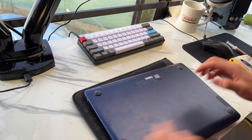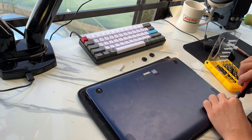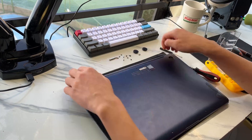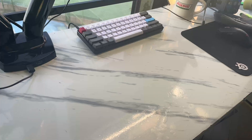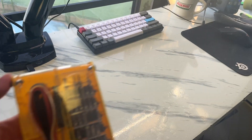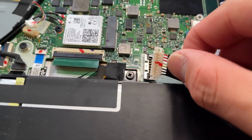Alright, let's open up the laptop. There are going to be a couple of screws, some of which are hidden under the rubber feet. In this particular case I have security screws, so I need specific screwdrivers with the right bit to disassemble the laptop. Once the back cover is removed, it's really important to disconnect the battery before messing around with the motherboard and CPU. Once that's done, press and hold the power button to release any residual charge so the computer is safe to work on.